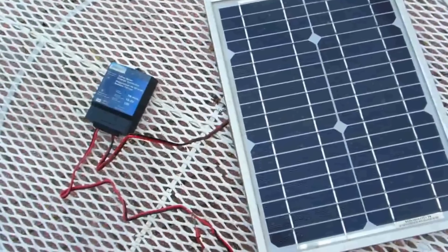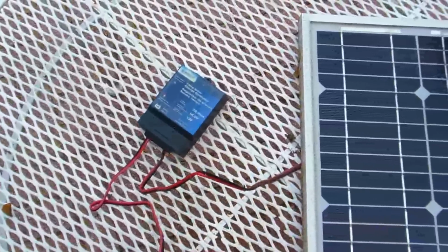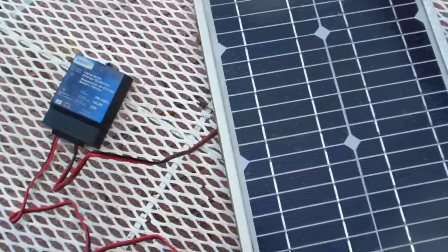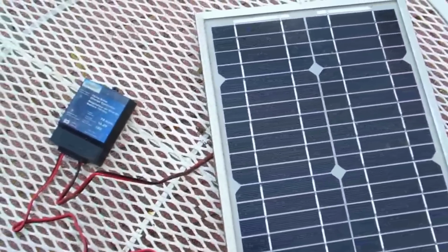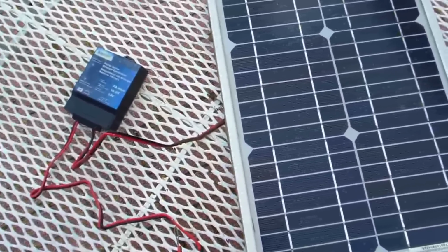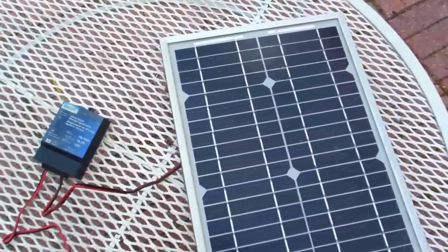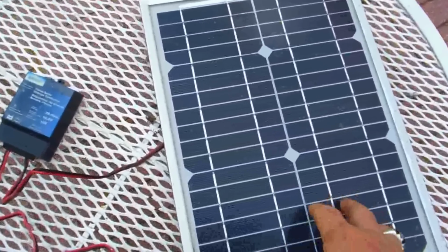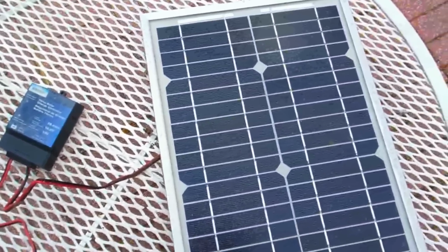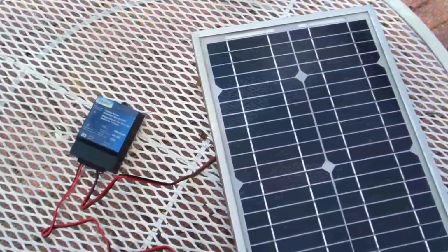If you have a situation where you need to charge the battery up, you need a little bit bigger panel like this and a charge controller. But the beauty of that other thing I was showing is if you just have it on the battery and you have a car stored someplace, they'll use those types of things in the military. They don't even use the charge controllers. Sometimes they'll use a special electronic device that desulfates the plates. But if your vehicle's sitting someplace, or you're storing a battery, you don't even need something this good. This is not a big panel, but this is enough to actually charge a battery up, with a charge controller. You could just get something simple that puts out 1 watt.